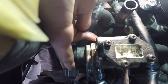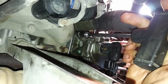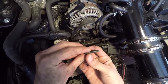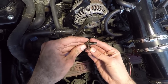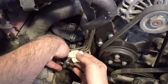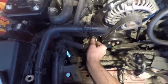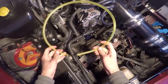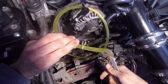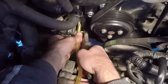Position the external parts of the OMP and push it into the Sohn adapter until it clicks in place. Take your new long bolt, slide it in the front hole and tighten it with your hand. Do the same for the two long rear bolts. Tighten the rear ones with the T-handle and the front one with your mini ratchet. Now take the bolt from the oil line, slide on the washer, then the oil line, and in front put a big copper washer. Put back the oil lines and tighten them — but don't over-tighten. Put the lines in front of the coolant tube so you can pull them further due to the extra space the Sohn adapter took. Put back the coolant tube and slide the clamp into place. Take the tube that came with the Sohn adapter, squeeze the clamp with plumber pliers, put it on the tube, push it all the way up the adapter's receiver, then secure the clamp in place.